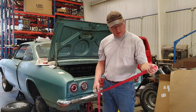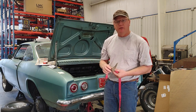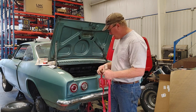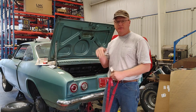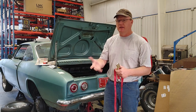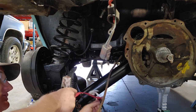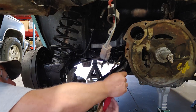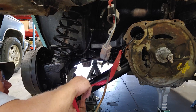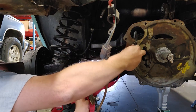So the engineers really probably should have named the lower control arms, well, the only control arms, the hobo arms, or the bum arms, the drifter arm, I don't know. Because the angle of the dangle of the spring forces it down and out. The hobo arm, down and out. There is no slide to this drive shaft like a normal drive shaft, obviously. It's solid. It's the solid connection between the gearbox and the suspension here. So the suspension has to move. And as you can see, the angle of the coil spring forces the thing down and out.